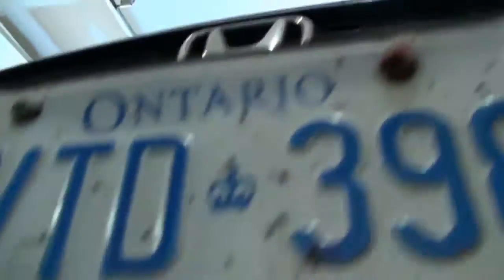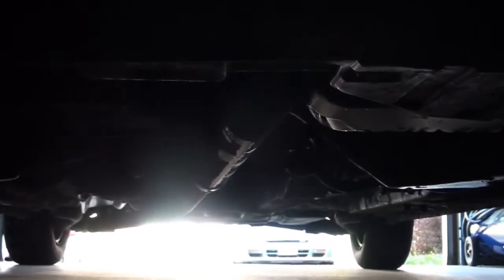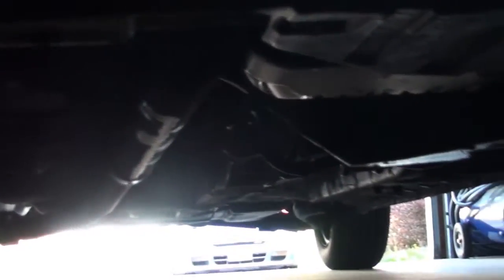You can see there's some oil here and there — it's probably the oil pan or the oil pan gasket. Either way, our oil pan is pretty rusted, so I'm just gonna replace both. First things first: jack up the car and drain the oil.